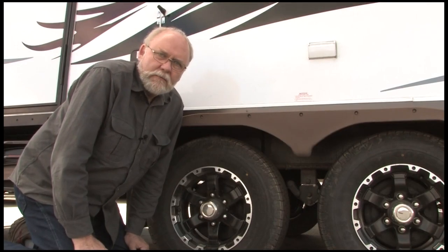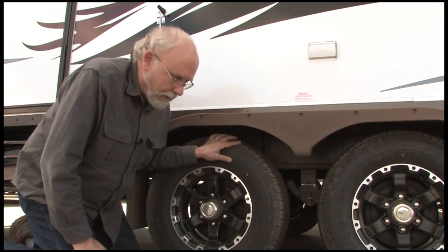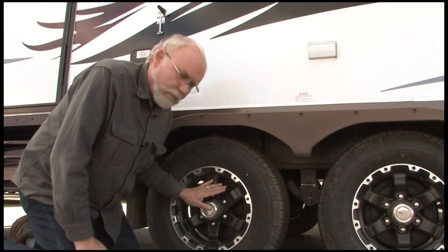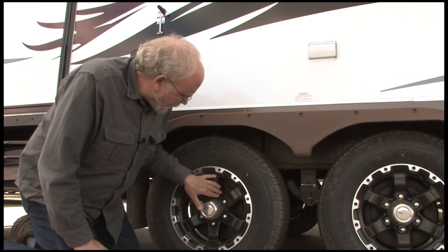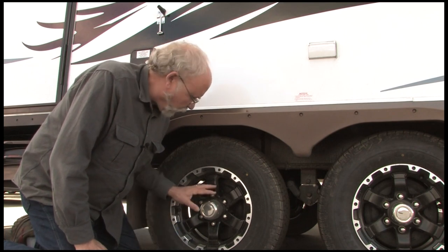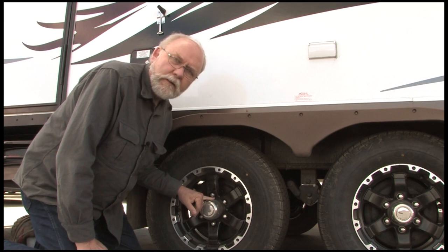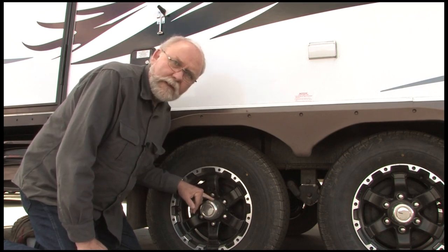Next up are your tires and wheels. Look for low inflation pressure and check for any signs of damage. Hold your hands near the hubs to feel how warm they are. If you're careful to avoid being burned, touch the wheel or hub gently to find out if they're all running about the same temperature. If one of the hubs feels really warm compared to the others, it could mean the bearings are going bad — that would call for a stop at a service center.